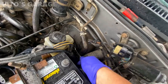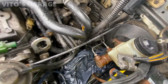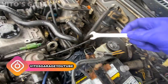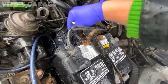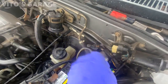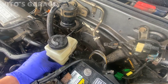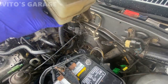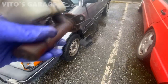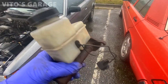It's not too hard to remove this — just two mounting bolts and those two lines already loosened. I'm going to take this out and put a trash bag right there so the brake fluid can drain into the bag and not all over the place. There she is — carefully take it out because it's going to be dripping some brake fluid. This is the bad boy we'll be replacing, though we're going to reuse the master cylinder reservoir.